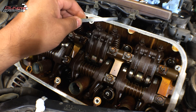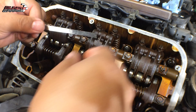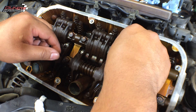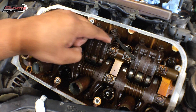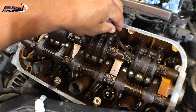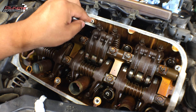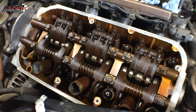This is the intake. Obviously the intake valves are closer to your intake, and the exhaust valves are closer to your exhaust. I always check them. I have my 0.229 feeler gauge here, and I'll take it and just slide it underneath the adjustment. It's sitting right there and I really can't move the gauge at all. So I'm not going to touch that — I'm not going to adjust this at all. Go to the other side, slip it underneath here — and it's good. Take the feeler gauge out.